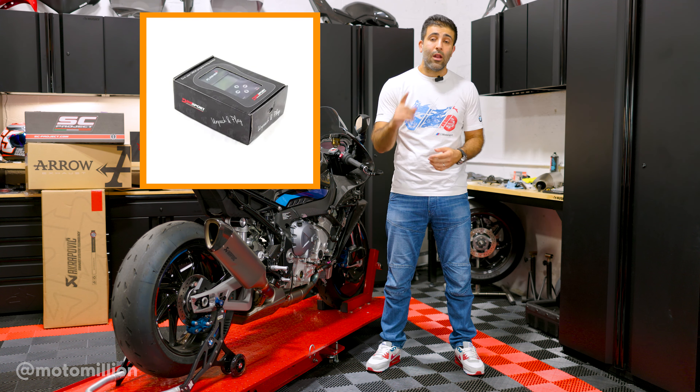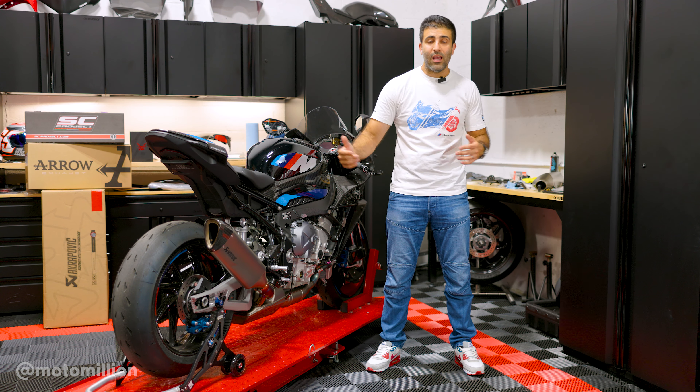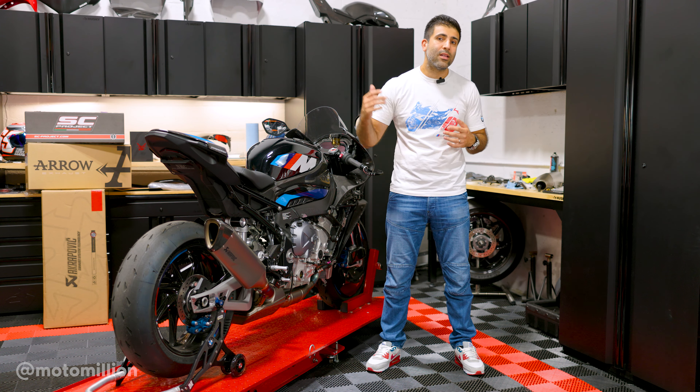You don't have to do it, but one subject that hasn't really been talked about is that the stage one flash — even if you run the stock exhaust — changes the way the flapper valve works on the bike, and the bike instantly gets louder. It's not as loud as a slip-on or full system, but there is a notable difference. Stage one is the flash that removes some of the restrictions and is 50-state carb legal. You don't have to do any extended mods like the flapper deletes or IAT relocations to run stage one, and the bike is easily returnable to stock with just the handheld.